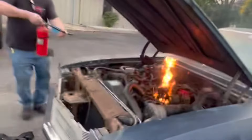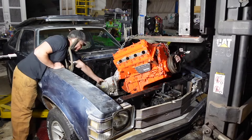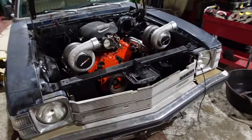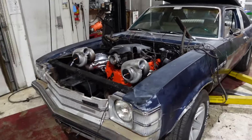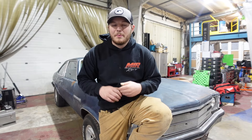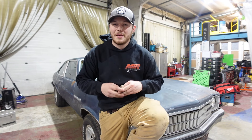So what we did was we actually bought a Silverado for really cheap, parted the whole Silverado out, yanked the motor out, rebuilt it, put a cam in it, and tried to build it as cheap as we could to get cheap power for a little money. In a previous episode we got the motor from the Silverado in this thing, got a turbo 400 bolted to it, and now we're trying to boost it for as low cost as possible. In the last episode we tried to do some management under the hood figuring out where everything's going to fit because putting a modern LS engine into an old car is not the most easiest thing. We're trying to figure out wiring harness and clean this thing up. In this episode we're back under the hood trying to figure out how everything is going to fit with our turbo kit.